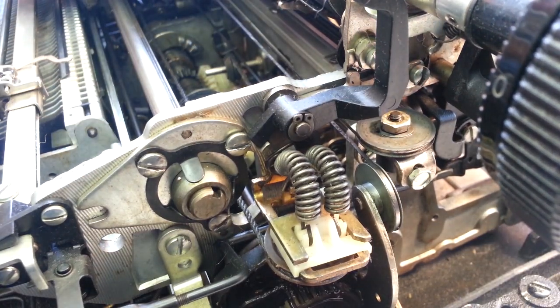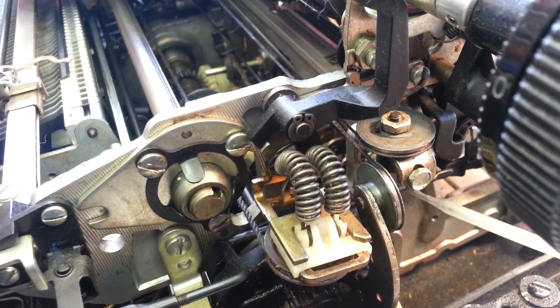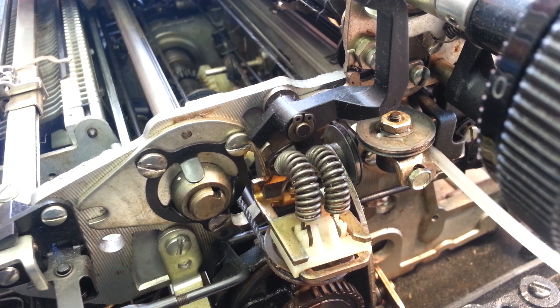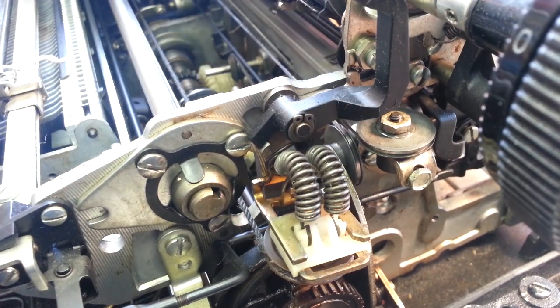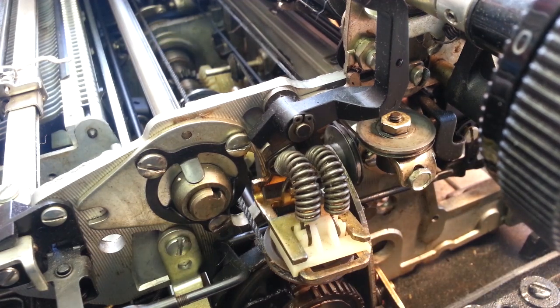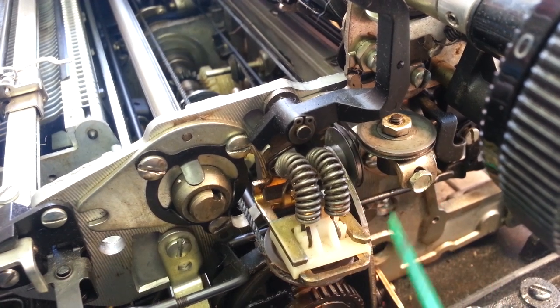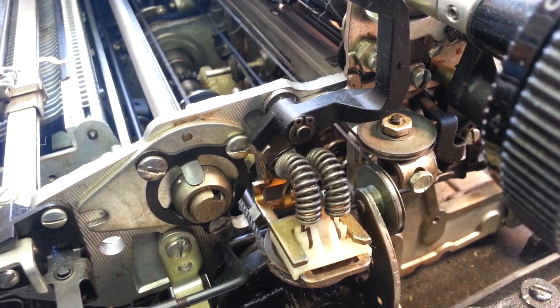To flush those out, you're going to want to use some degreasers. I use coarse lacquer thinner. It's my go-to chemical. You just soak these little parts, get right in the pivots, and get the machine on. Give it a little turn action up here, bottom, top of the tilt pulley, run that, and rotate a little more, and blow these out. Like that, maybe repeat the process.